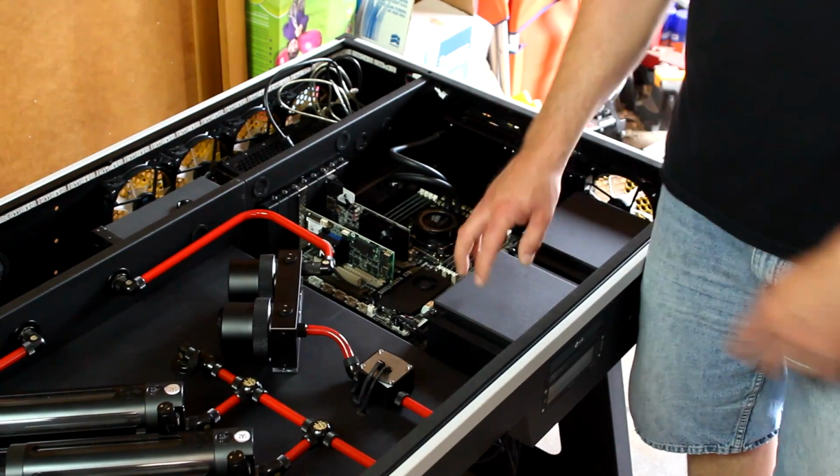As for this side over here, I did wire in the Aquaero 6 fan controller. It is fully plugged in. All the wires have been wire managed underneath the center area, and all the temp sensors are plugged in. Everything's plugged in. It's all labeled. I'm going to make a little diagram in case Phil ever needs to know what is what on the screen, but it's pretty much for my reference, so that when I set up each temp sensor I can label it as 360 rad temp or 480 rad temp or the overall PC temp, those kinds of things.